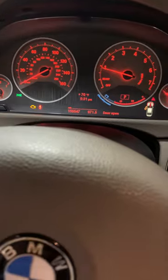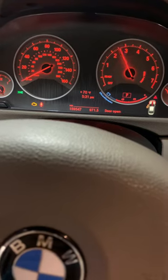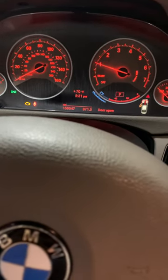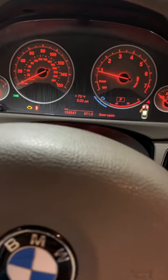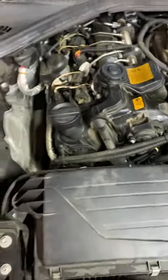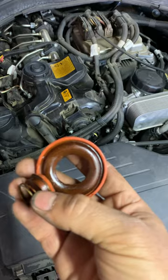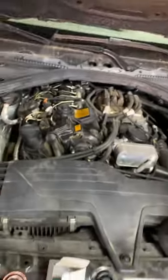It's the noise — the whistle right now — I have to drive around. That's normal, it's kicking out, it's not making noise anymore. So if you have this problem, check here — there is the PCV valve, you can see. I'll check. Thank you for watching.